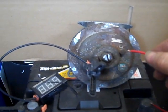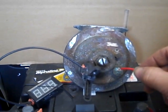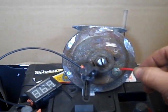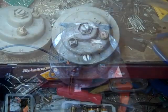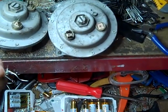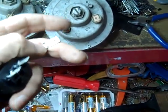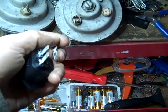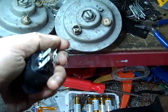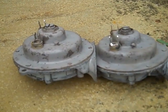Just to prove that the repair actually works, I'm going to press the terminal on now — and there you have it. To repair the terminals, I found an old socket that had three spade terminals on it, which is just enough to repair the three missing terminals. We're going to solder those on now, giving us four terminals back on each one.